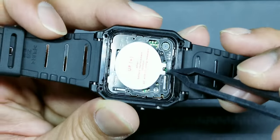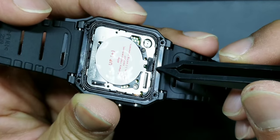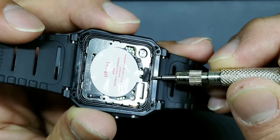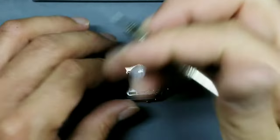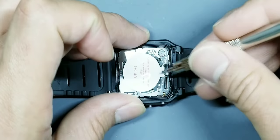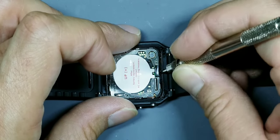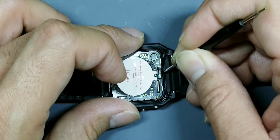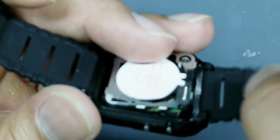To get to this module we're going to look at the six o'clock and twelve o'clock position. Right there at the tip of my tweezers is actually a small clip — you're going to find one there and another one at twelve o'clock. You're going to put a tiny bit of pressure inward towards the center of the module, just enough to kind of lift up on it, so you'll get a nice area where you can grab onto the rest of it and lift it up.